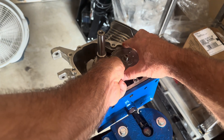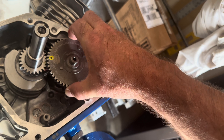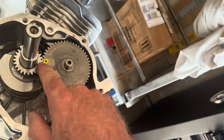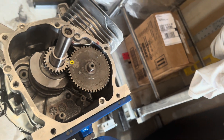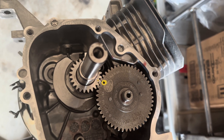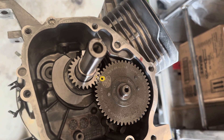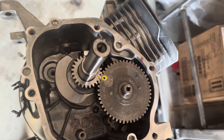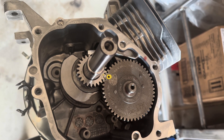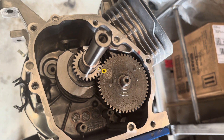We've got to line these dots up. Put the cam in carefully — the gears are angled but you can see the dots line up. I tried to highlight them in yellow so you can see them. Make sure they line up, and even rotate the engine a few times to be absolutely certain. That way your engine is in time. Remember, you've got four strokes: intake, compression, power, exhaust — all has to happen at the right time. Your valves and ignition all have to be timed correctly.